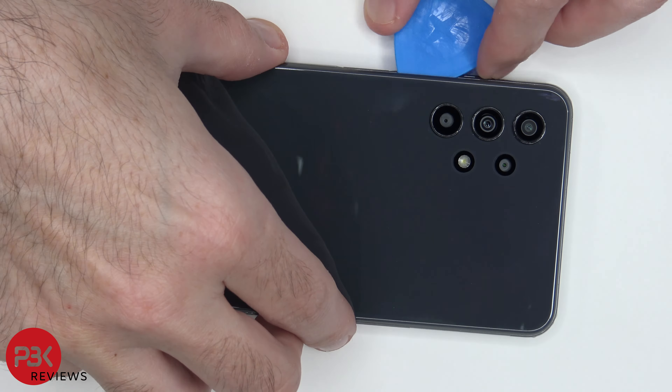Here we have a look at the plastic back plate. There are 16 Phillips screws which need to be removed. Once all the screws have been removed, we're going to disconnect the fingerprint reader cable.